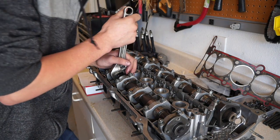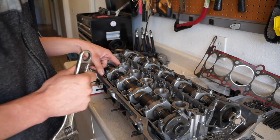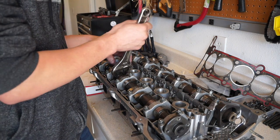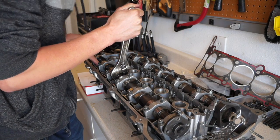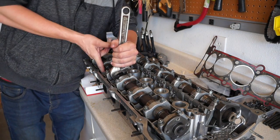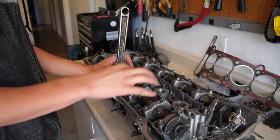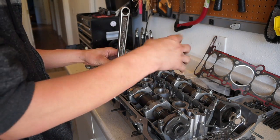So basically I'm going to move the cam around until I can rotate all of the lifters in their bores — that's how I know I'm at the correct spot. You can check by the lobe positions: one is compressed, two and three are all the way out, four is kind of off to the side and I can spin them, five is more pointing this way. I still have to turn it a little bit more on five. There we go — I can spin those too. So it's just going back and forth on all the lobes to make sure you can rotate them. I'll leave some forum links in the description so you can look more into it — don't just use my video alone, do additional research to fill in the gaps.